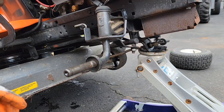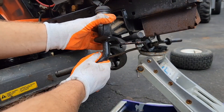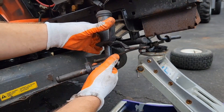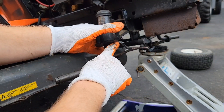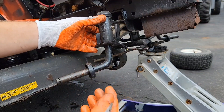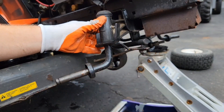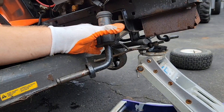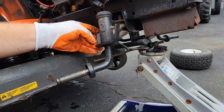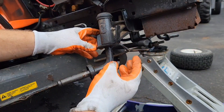We're on what would be the passenger side of the mower. Turn the wheel to the outside so you can see — what they did was they just bent this tab down and made the connection for the tie rod. What that does is create a little weak point here where you can get all kinds of twisting in this metal whenever you hit a good-sized bump, turn the wheel too hard, or something like that — where you actually damage and bend the metal slightly.